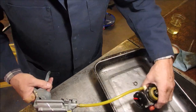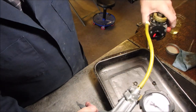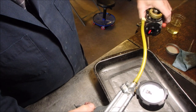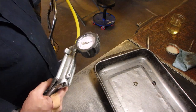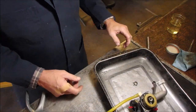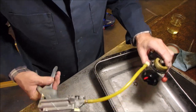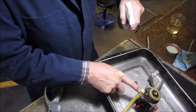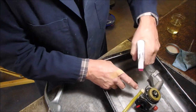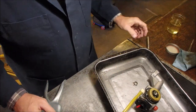It's leaking — only holding five pounds or less. I think I'm going to put a full carb kit in this one. I want to check one step up. I'm going to squirt a little bit of bubble solution on this connection here. Oh yeah, it's leaking.